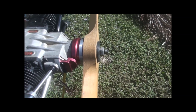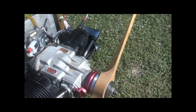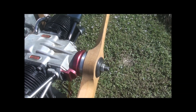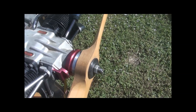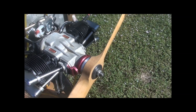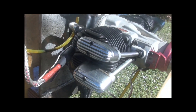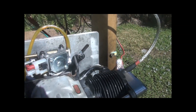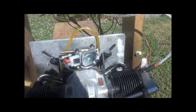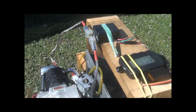It's similar to the 300. In order to have this done, I had to replace the prop hub drive with the one from the FA220 or the 300 — they're both using the same part number. So if you want to have one of those done, you'll need this prop hub. Other than that, I replaced the glow plugs with NGK ME8 and I adapted a carburetor. I'm using a Zama, but you can use whatever you like.